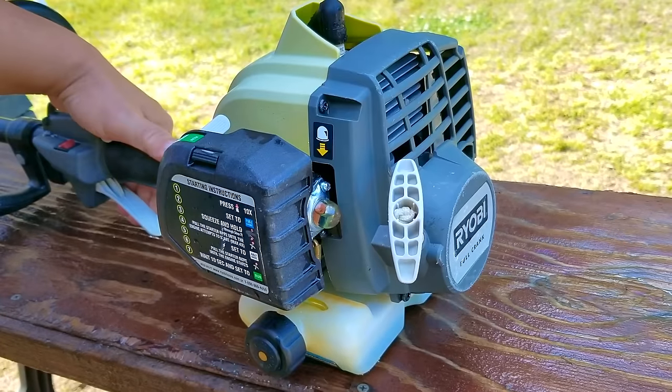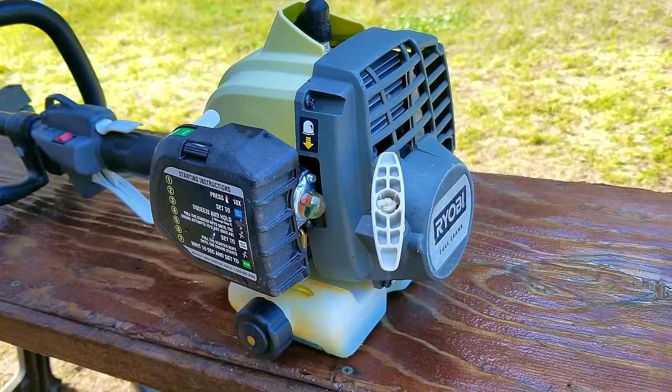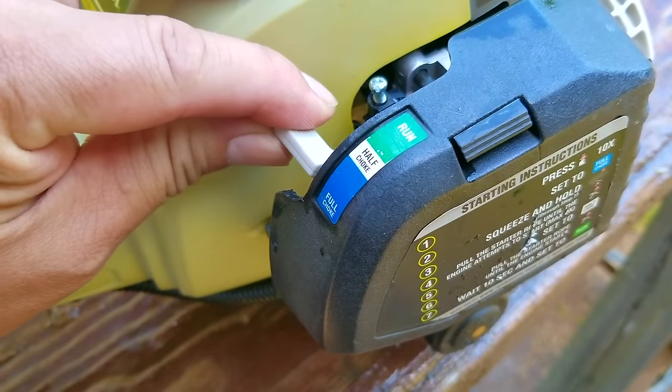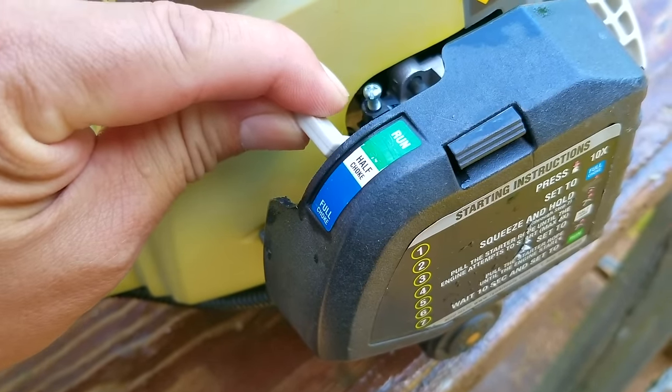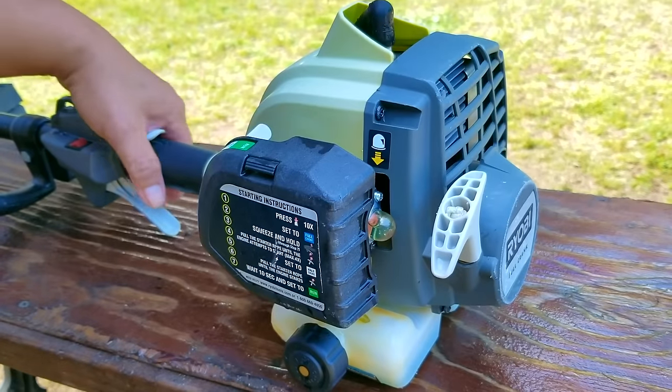So it kind of struggled to get started, but once it did, it performed just like I was told. Now my first impression tells me it's not getting enough fuel, so to test that, I'm going to try and start it again, except this time, I'm going to put the carb's choke lever somewhere between full and partial choke, instead of completely in partial choke.